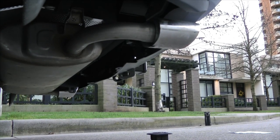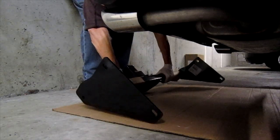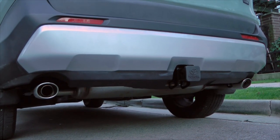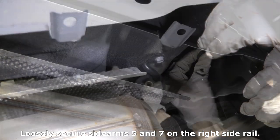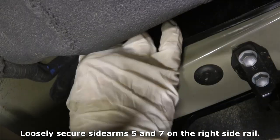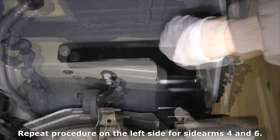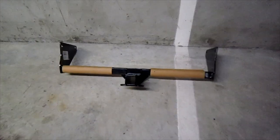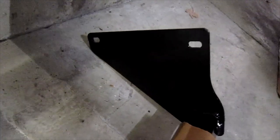This is how it looks from the side. Previously we had installed a different, aftermarket hitch on this vehicle. The reason why we decided to switch to the original is because it has eight bolts that mount the hitch assembly to the body or frame of the vehicle, which divides the load more evenly. The aftermarket hitch had only four bolts holding the assembly in place.